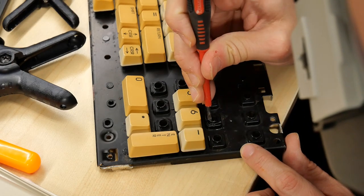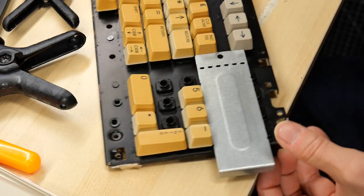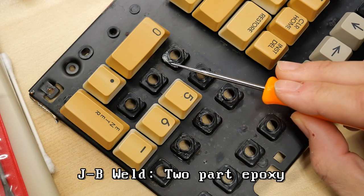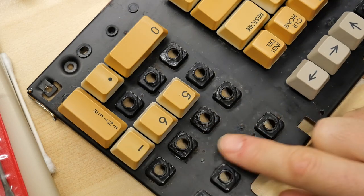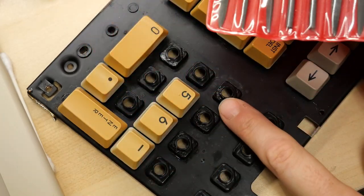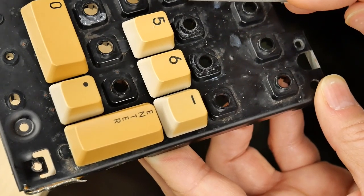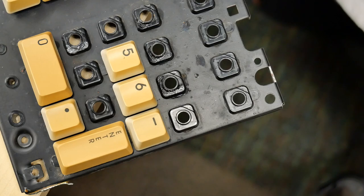This is not gonna work. I'll clamp it and if it glues this piece of metal onto these keys, then so be it. It's the next day — I left this overnight. These three had crazy glue on them, and this one I didn't clamp because it wasn't really bent out of shape. I just used JB Weld on that to reinforce it because it had a crack in it. I should have just used JB Weld originally. Now the plungers fit through these fine, but it's a little jagged on the inside, so I'm gonna take these little files here, find a nice round one, and try to file away the rough edges. That seemed to have done the trick — the tops are a little ugly but I'm not seeing any rough round nubs anymore. Not bad.